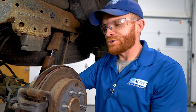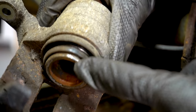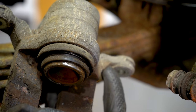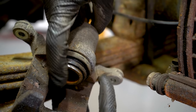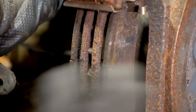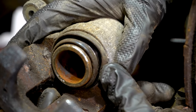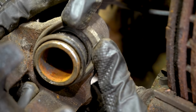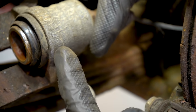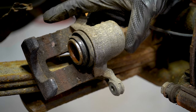Now let's talk about what could happen behind your caliper. I'm going to slide this right off and we can look right here and find our caliper piston. This is the muscle of your brakes — essentially every time you step on the brake pedal, it's going to force fluid down through your flex hoses and force it out through this piston, pressing the pads together and creating the friction that makes you stop. What can commonly happen with these pistons is they get seized up. If the boot rots or breaks like this one right here, there's always the possibility moisture can make its way in there and cause it to seize up — meaning you can press with all your might and it just will never go in.